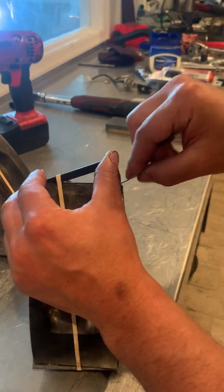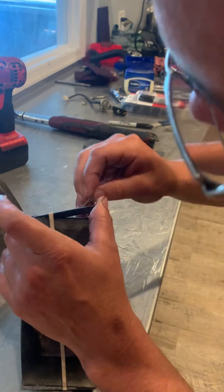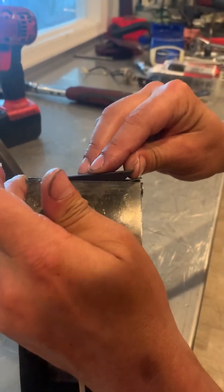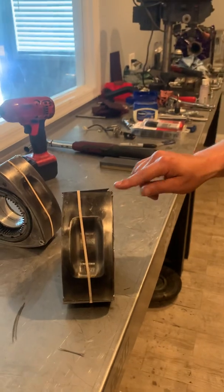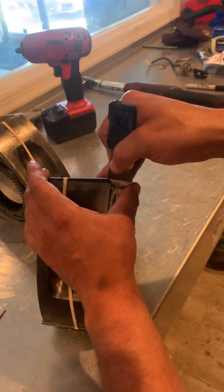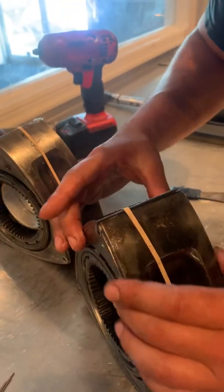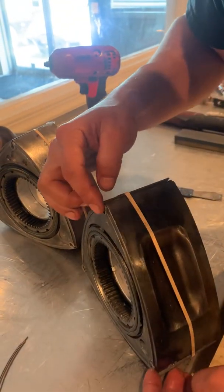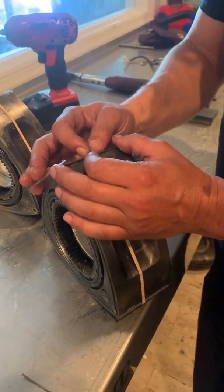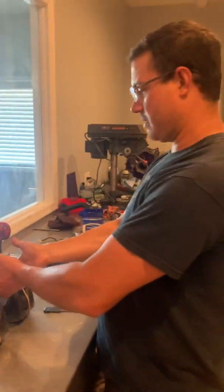It just makes it so much quicker. You just drop the rotor in, put your corner piece in, drop your plates and just stack. No time, no fuss, no muss — it's really easy. Check it again, make sure your little tips are there and voila. Now sometimes the spring will come out this side just a tiny bit — just come in here and slide it back until it stops, right there. Make sure whichever end you're dropping in first that your seal is all the way in like that, so it can't move around when you drop it on. Put your rubber band right in the center. Apex seals are in. Easy peasy.